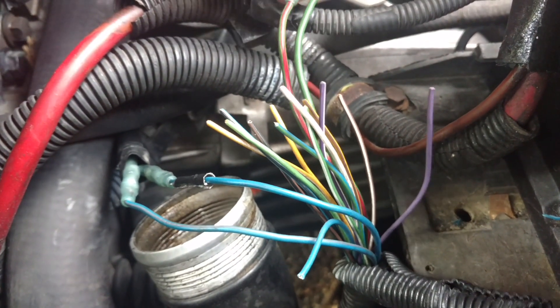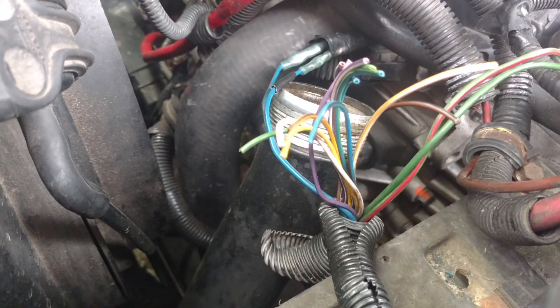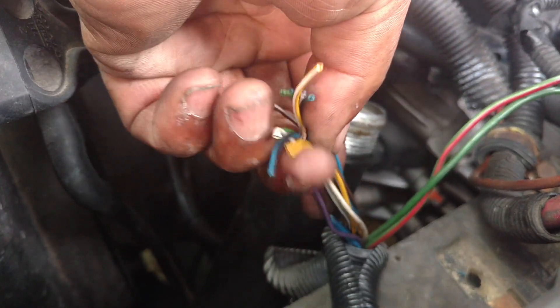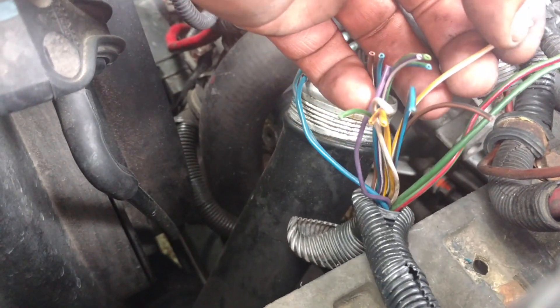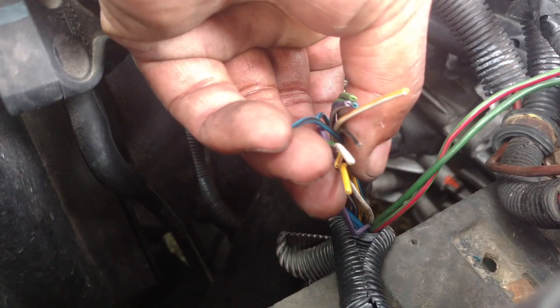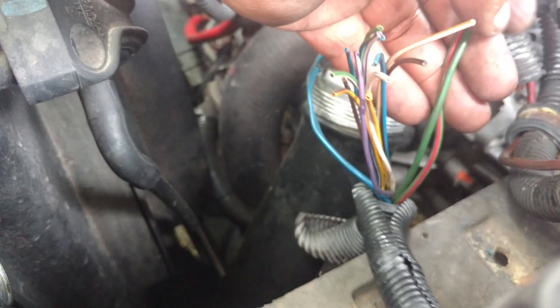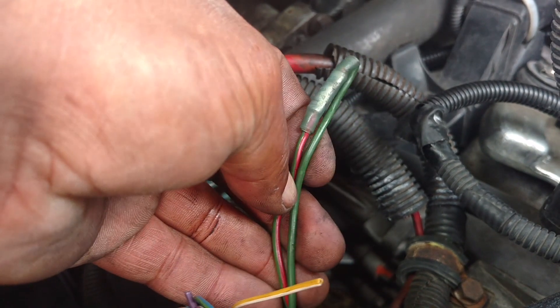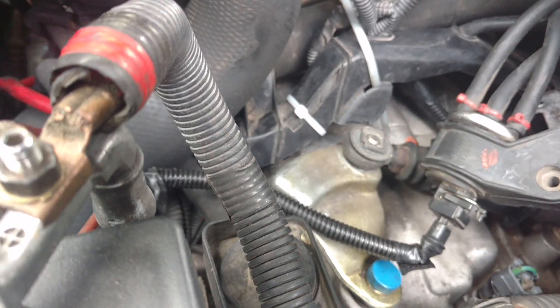I want to point out that the wires to jump the starter are a green with a red stripe and a green. I pulled on each one individually to stretch the wire insulation over the end of the wire. You could tape each one, or you could try to stretch the wire insulation over each wire and then tape them up that way — you don't want them to short out. You could also cut them all different lengths. I'm also thinking about running a pair inside the car to that clutch switch to control this by the clutch, so I'm going to temporarily stow this and contemplate on that a little later.